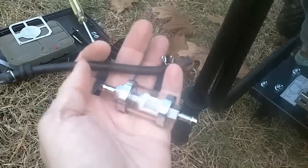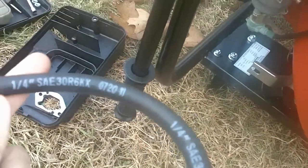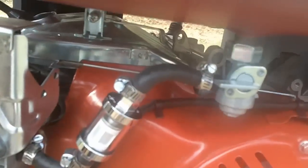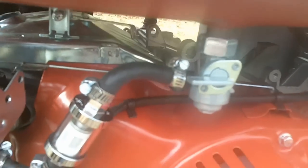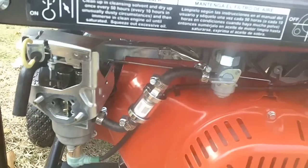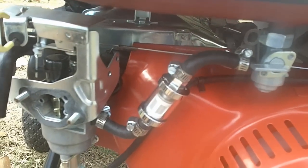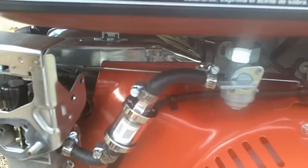I also bought some extra gas line hose — notice how this hose is a lot thicker and rated for pressure. You can use either one; with some hose clamps it would work just fine. So we've installed a fuel filter — nothing radical here. We used a little bit heavier gas line and proper hose clamps. This is an easy-to-service gas filter; this particular filter comes apart so you can clean it. You don't have to use this type — you could use a throwaway type. These things cost anywhere from fifty cents to five dollars depending on the type of filter. This is going to keep the gas a little bit cleaner going into the carburetor.